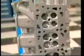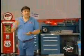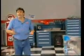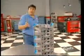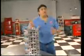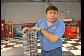If your engine was built before November 1st and you hear that ticking noise coming out of the driver's side, chances are you've got some valve guide wear. And what Ford would like you to do is bring your Cobra into the dealership, have them check it out and see if the cylinder head needs to be replaced.